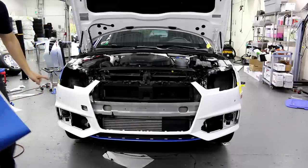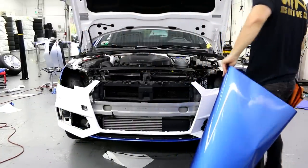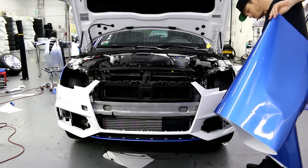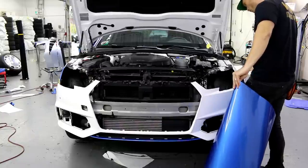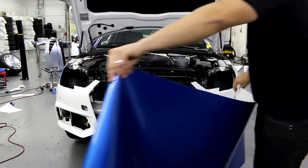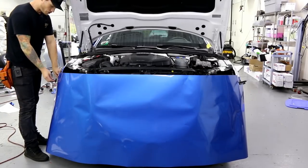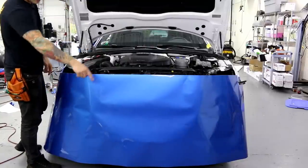The side markers do not come out of this car — they're plastic welded in, and I don't have a plastic welder, so I work around them. That's the only part that's a little touchy, requiring a bit more care. My piece is going to be much longer than I need for the front bumper because I cut it from the rear bumper piece — both bumpers being shorter than 30 inches tall, so we can get two bumpers out of one sheet.